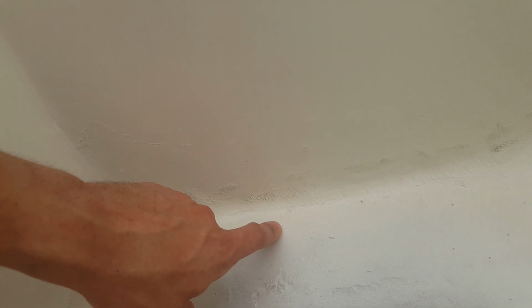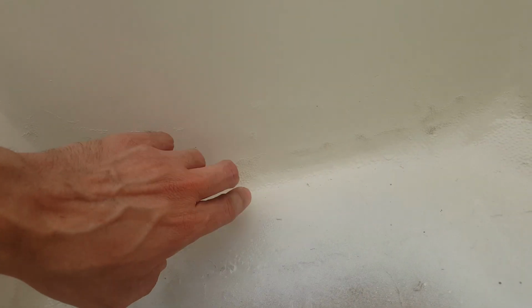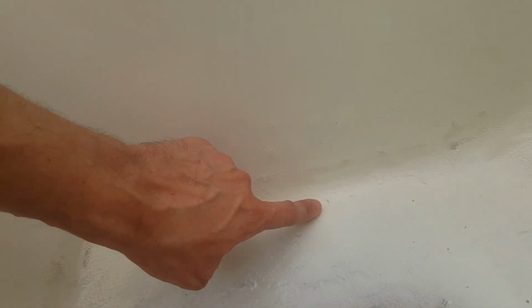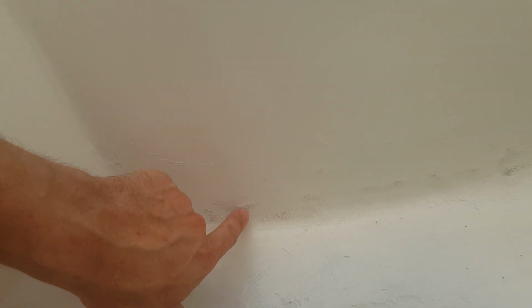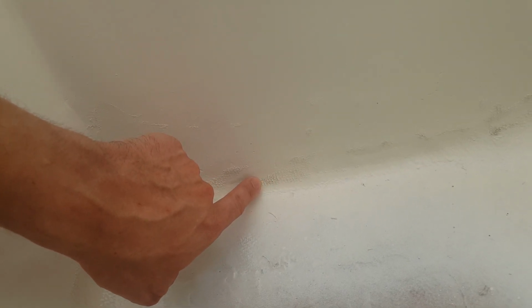And the problem is with this gap, you're gonna have to fill it in with something. So I used Kevlar and epoxy, and I could tell you right now, it's super strong. It's not flimsy by any means, but the problem here is with Kevlar, it doesn't sand. Really, it doesn't really sand at all.